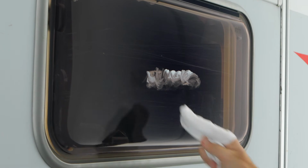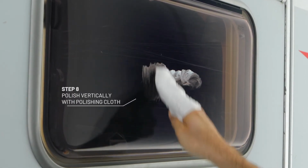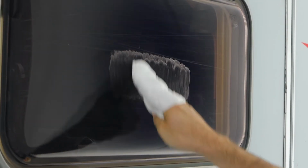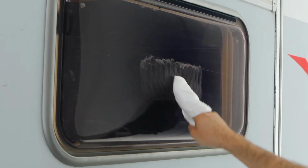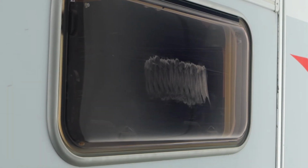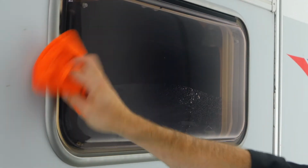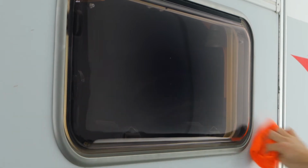And here we go with the polishing. Simply polish the scratched area for 2 to 3 minutes with strong pressure, using the polishing cloth until the scratch is gone. Wipe off quickly. Clean again. Perfect! No expensive workshop necessary with the professional do-it-yourself solution by QUIXX.